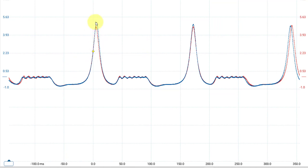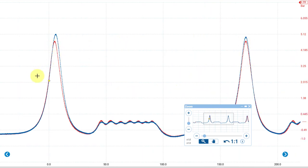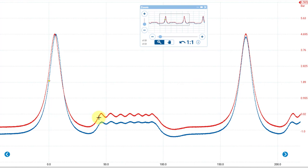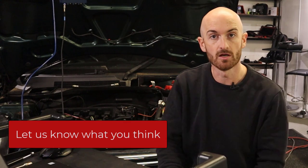For the overall compression of the waveform I think we are about the same — the solid pipe is showing a little bit higher. We have got the engine speeds about the same, so the peaks are around about the same point, which means we've possibly lost a little bit of compression in the longer, more flexible pipe. The other interesting thing is the exhaust event: with the flexi hose it's much more wavy with more variation, whereas with the solid hose it's a bit more flat — almost like there's less give in it, possibly pressure pulsations. That's quite interesting to see. It'd be good to know what you think between the two and how much that might affect your diagnostics, so let us know in the comments below.